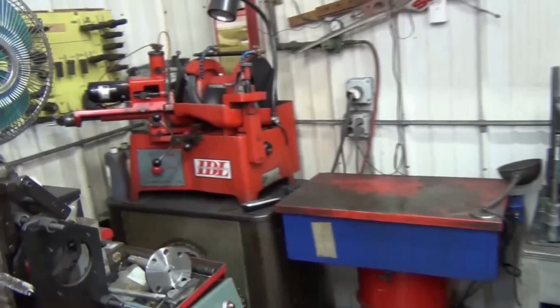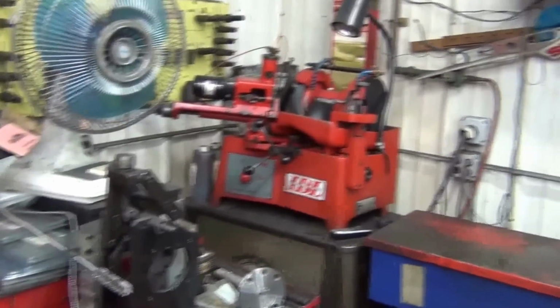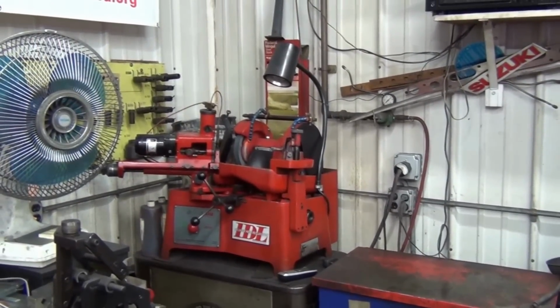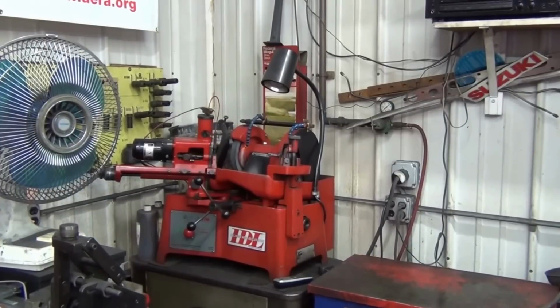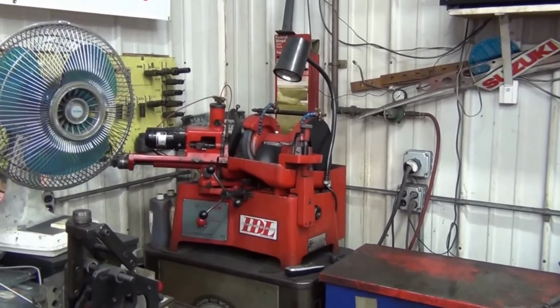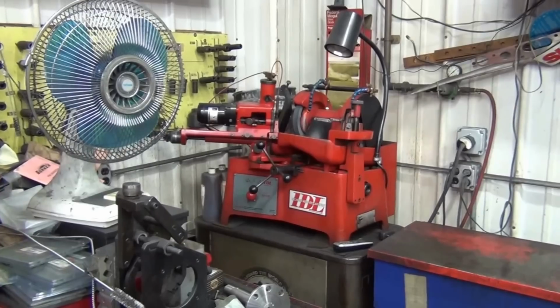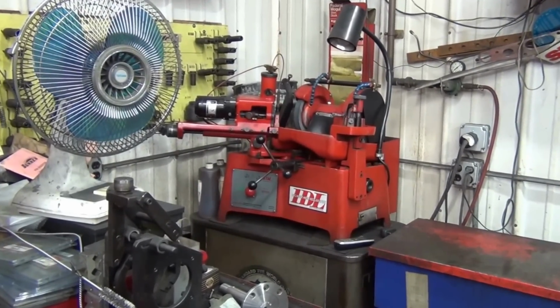Depending on the finish that you require, you can dial it right in. And that's our centerless valve grinder in the corner, where we grind the valves and stems back to better than new precision, because the new ones come in all crooked and bent. Practically all the new ones have to be reground. Is that the new one? Because they're not within tolerance. Yeah.